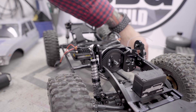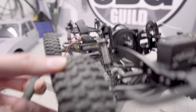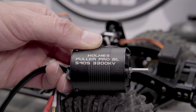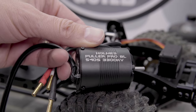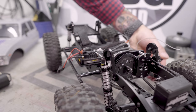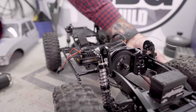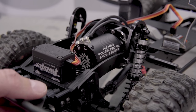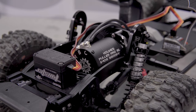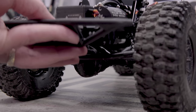Clocking this motor plate won't allow for a full 540 can motor to sit in the spot without affecting where the servo sits. I didn't really want to adjust that and make another set of changes, so I just went with the Holmes Hobbies Puller Pro Stubby 3300kV motor — I thought that was a good KV rating for 3S. I am running it on a smaller tooth spur because everything gets pretty tight in there and you don't have a lot of freedom of movement of that motor. So I went with the 56-tooth 32-pitch spur gear from RC4WD designed for the R3 transmission, and a 12-tooth pinion to go with that spur. You'll probably notice that your top link is getting in the way of that motor and reducing the clearance you have. So what I did was make a bent-up third link that I shifted to the other side of the chassis. Because I've bent it so oddly, it actually does a great job of clearing that whole transmission and doesn't create any binding when you cycle the suspension.